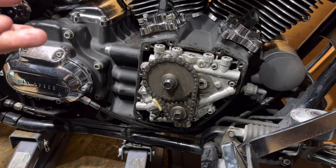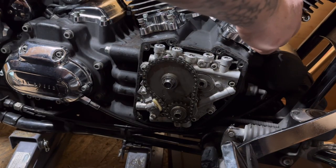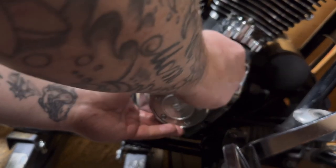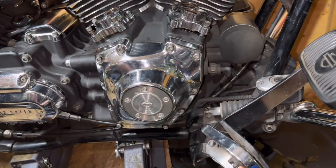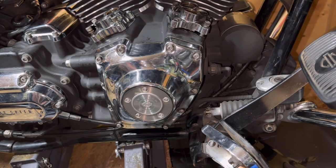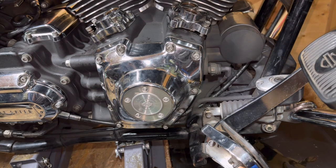Next, the nose cover back on. Gasket face is all good, clean. And remove the magnets. That's that back on. Well, next job is make sure we're back on top dead centre on the cylinder, then put the push rods back in and adjust them up. I've got videos on how to do that already. If you look for my videos, I'll put some links in the description on how to find top dead centre and how to adjust your push rods.